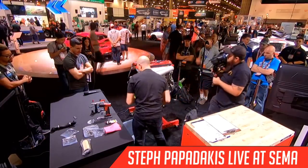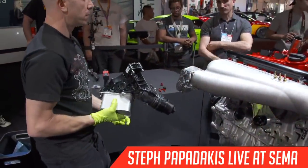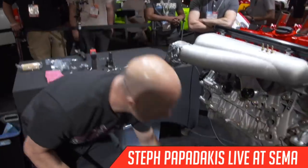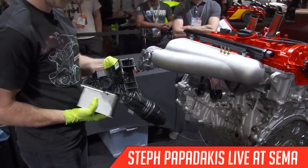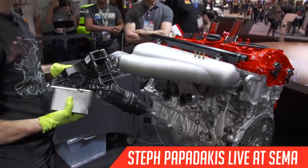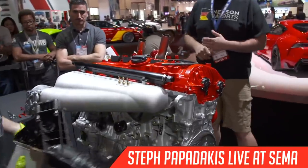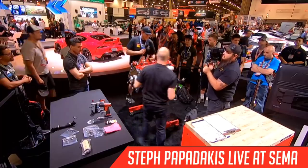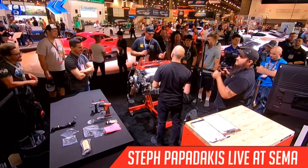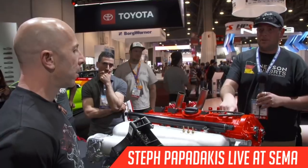Okay. Is there a valvetrain motor up on top where there's an adapter plate now, it looks like? On the backside valve cover? I should have referred to the high pressure pump. Right up here. Well, it's pretty common. BMW has a valvetrain motor that runs the eccentric shaft to help make for the VVT. Did you use an adapter plate, or is that just how they come in the Supras?